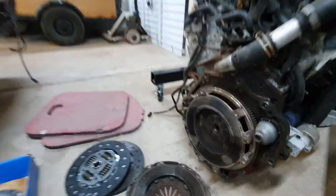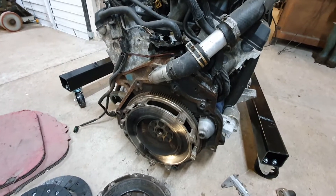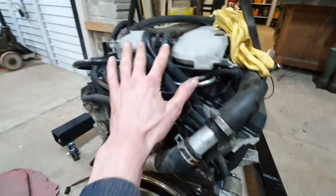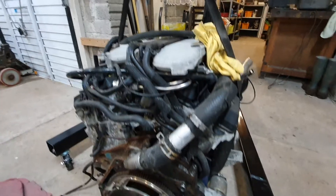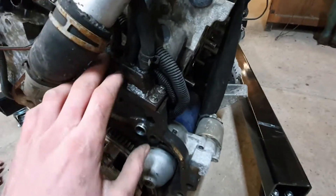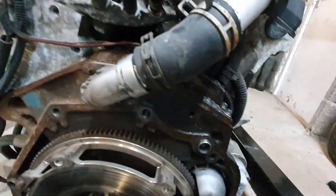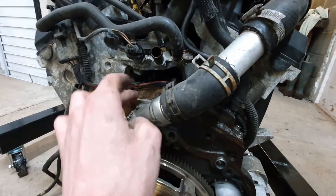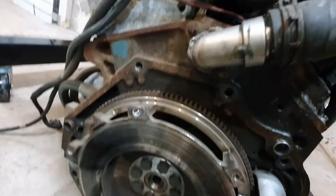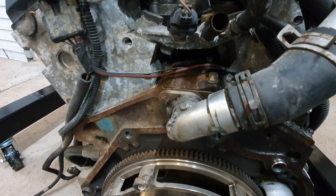And then lastly, not quite so interestingly, is the back of the engine. It had a huge water manifold thing here which would have fouled the bulkhead, so I did a lot of work. Oh yeah, and the breather — there's another one for the engine there. Breathers from the engine go up through these sort of snorkels up to the throttle body and get breathed in, so there's no emissions except those out of the exhaust. That water manifold had to be greatly reduced, so I've made a very much smaller version with all the breathers on it. Looks like there's a hint of an oil leak from somewhere, but that's not enough to worry about for now. The water manifold was enormous — it came way out and then came around the side of the engine and forward — but this does the same thing much more tightly, with some absolutely shocking welding that I'm really quite embarrassed to show. But as with everything, it works fine — it just doesn't look good.